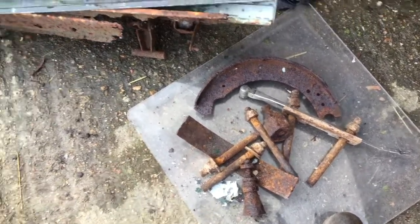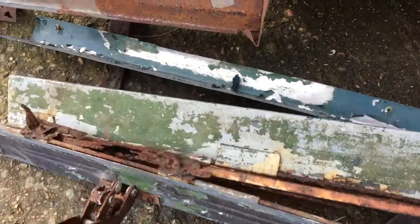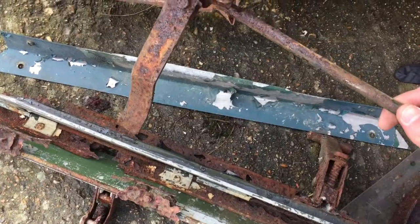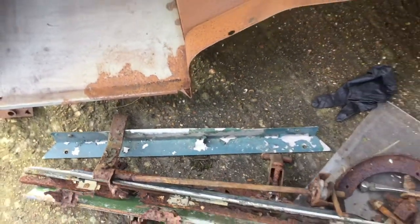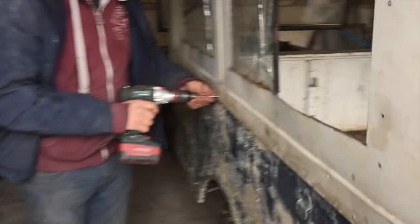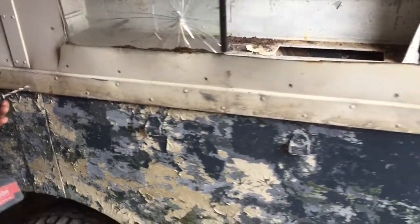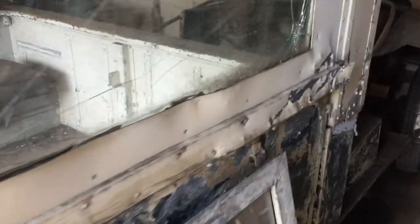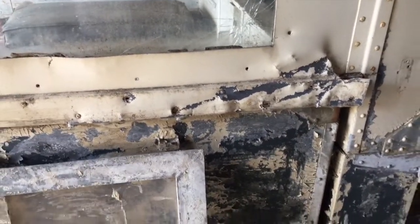Various brake bits and bolts. Here's what's left in the top rail from the bulkhead, plus the vents. I also found the accelerator pedal, which is pretty seized. Steve's arrived with the drill. What we decided was, let's get the top of this off. It's not bolted on - it is literally riveted on. So we're going to drill them out. Someone did start on this side already. Any of you guys on Facebook who used to own this can admit to that. Anyway, it's coming off and a new top rail is going to be cut and put on.